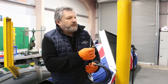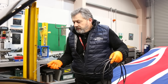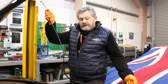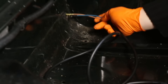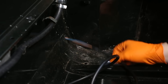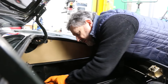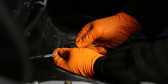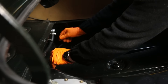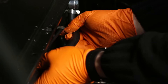We have a nice little weatherproof connector at the pump end, so that will be in the boot. I've made a small hole in the boot to take the cable which feeds power to the pump. I'm just going to pass that through now. This is going to go under the car, over the rear axle, and then it will follow the fuel line through to the front of the car. I'm just going to make the connection to the pump — that's connected. Then I'll feed that through using the original clips and the grommet, and it's done.